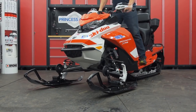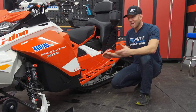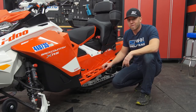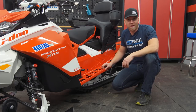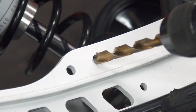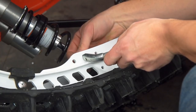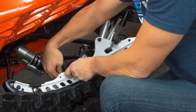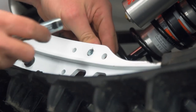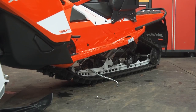While we're on the topic of safety on hard surfaces, I want to talk about keeping your sled safe on hard frozen groomed trails or anywhere where you're not getting enough lube on the rails, because this long 146-inch sled can get a little warm when you're trail riding. Ice scratchers on this big sled are a must. These Kimpex 12-inch steel scratchers are designed for sleds with less than a two-inch lug. They're easy to install and can be left down when in reverse without the worry of bending. They are reverse-threaded and come with Loctite to ensure they stay put, and they have a built-in serrated carbide tip so you get years of worry-free use, keeping your engine cool and your slide rails lubed.